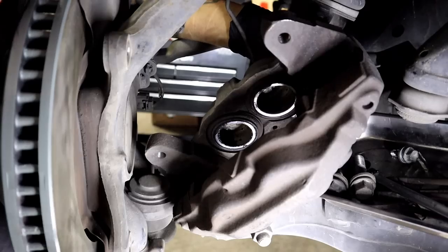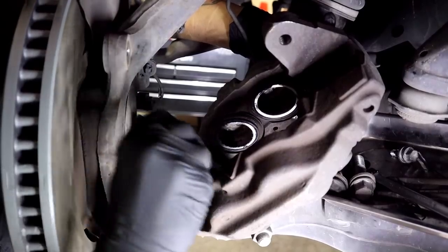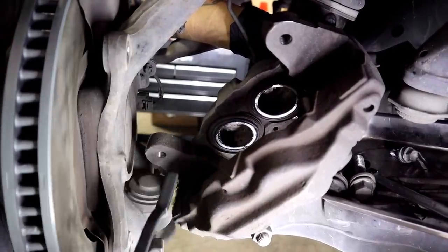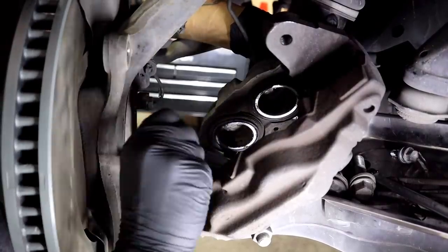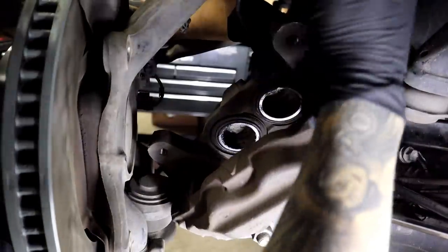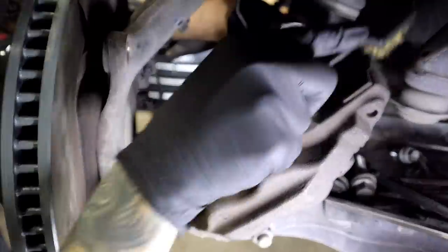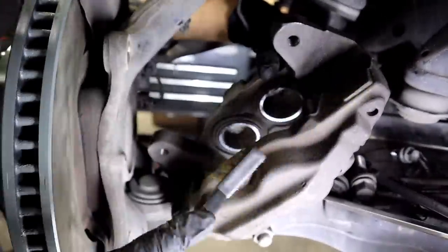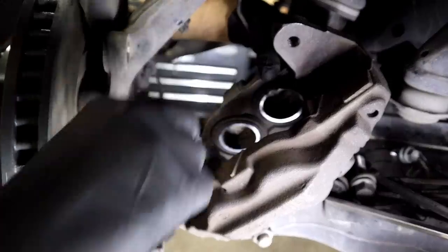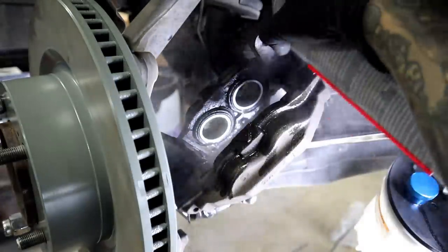So now that the rotor's back on, time to put the caliper back on, right? Not so fast — we've got to clean it first. You're not going to take a shower and then put dirty clothes back on. So same thing true with this caliper — it is full of brake dust, it's full of old goo. You want to be really careful when you're cleaning the caliper — there are little rubber seals around the caliper piston, so you don't want to puncture those. If you damage the rubber, that will cause dirt and debris to get in there, ruin the seal, and can actually seize and ruin the caliper. I'm also making sure to clean the points where the brake pad touches, because I'm going to be lubricating those later on, and that will actually help the brakes not be loud and squeaky. Definitely don't rush through this stuff. Then going back through with brake clean. Unless you're wearing a super heavy duty mask, do not use compressed air to blow the dust out.